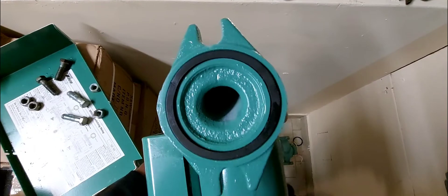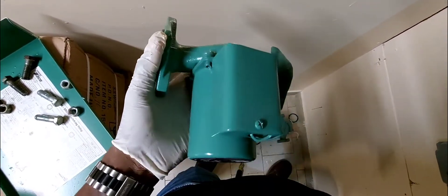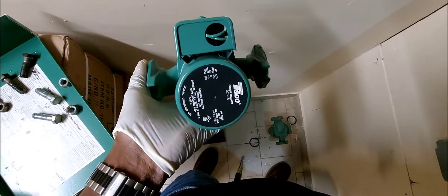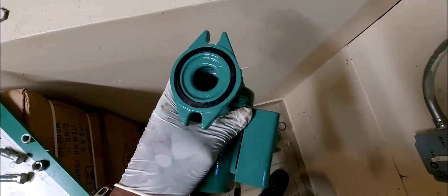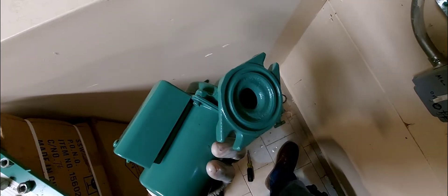Here's the new pump with a gasket sitting on it. There's a groove on the pump so the gasket sits in it — just take your time and slide it in. It might fall out if you shake it, but just be gentle and it will sit there nicely.